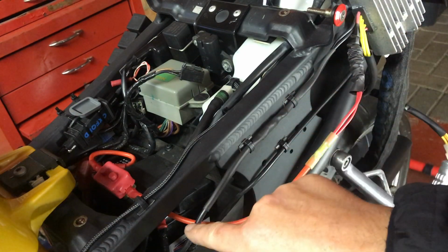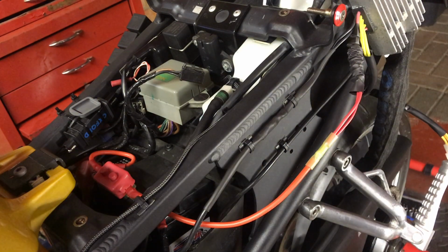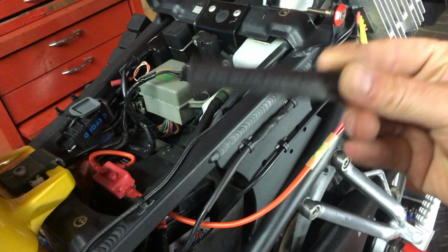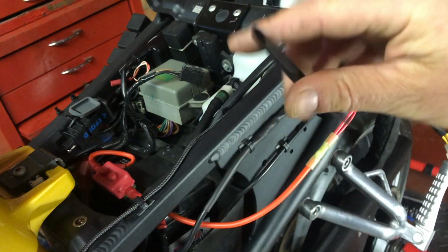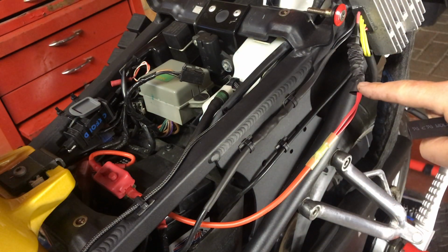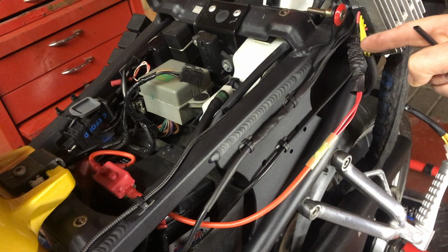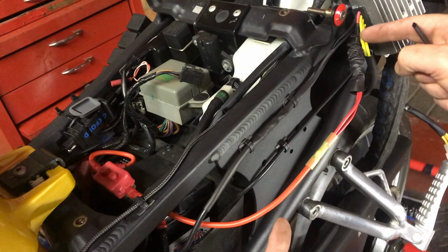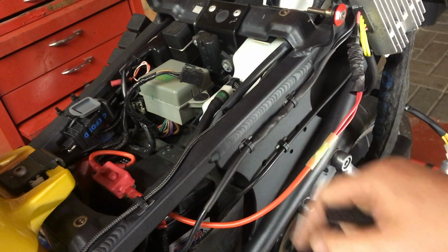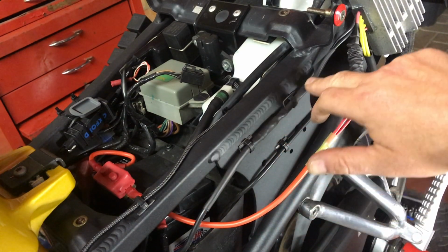I'm going to put a sleeve on. Okay, so I've just figured that out. There's a bit of plastic sleeve in here. I got a small bit, so that's kind of what that looks like. I don't know where I got it from, probably Amazon or eBay, one or two anyway. You can see it just comes flat on a roll, and you just open it and pop your wires through. Don't forget to put it on before you make your connections. I've just ruched it all up at the back there. When I've sorted this out, I shall ruche it down, and it'll probably cover about that much there, which is all I want it to do, because you can see it's heat shrunk really well, nice and tight on the wire there, nice and tight over the connection, and nice and tight here as well.